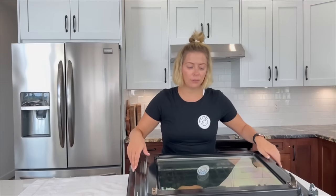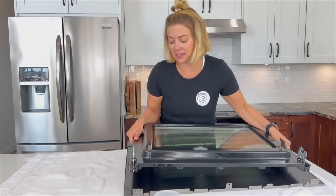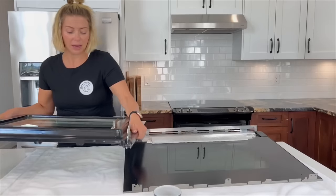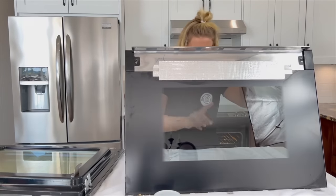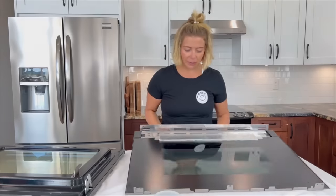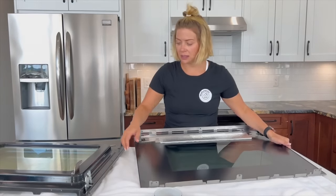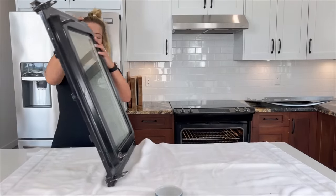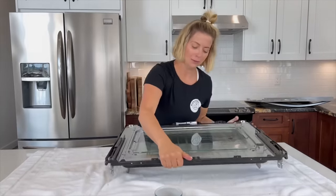Once your screws are completely removed, lift the glass up — be really careful here. Remember there's a third pane of glass that may be a bit jiggly; not all oven doors have three panes but this one does. This part of the stove isn't very dirty — there are just a couple of drips I can see, so it'll be easy. I'm going to move this one over and take the other part apart. Now I flip it over to get to the pane, and you can see that there is indeed a third pane of glass in there.